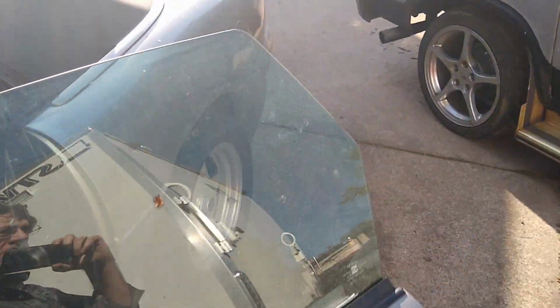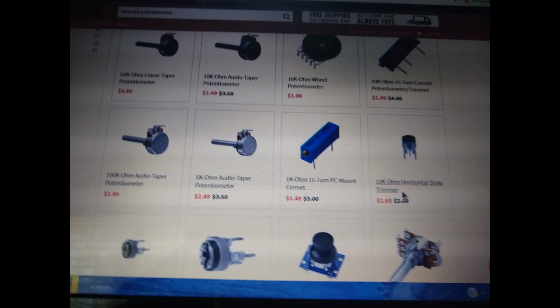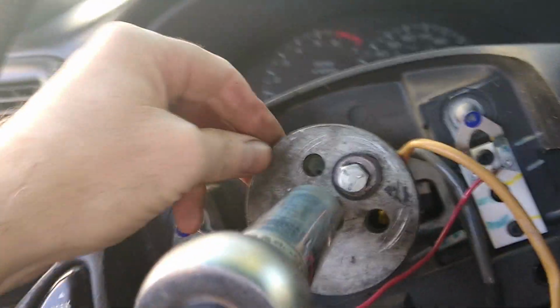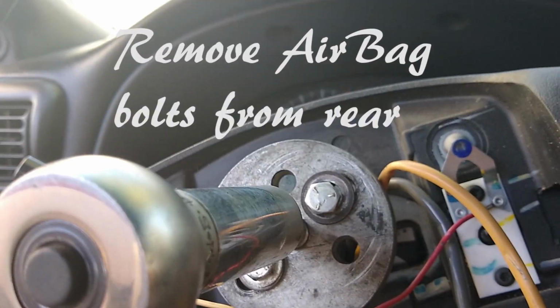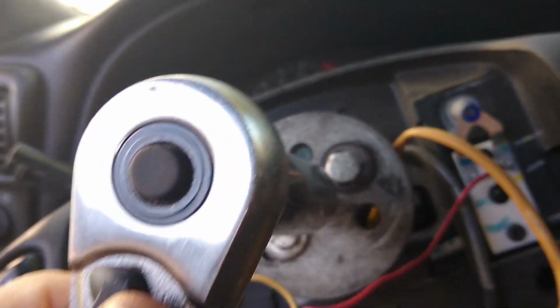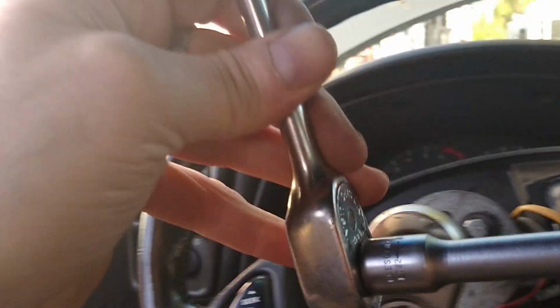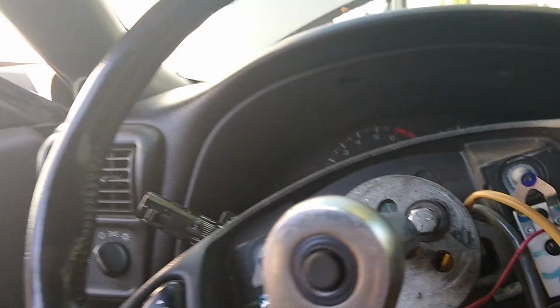So what we're going to do is show you what we got. And here's my trusty old gear puller from 50 years ago. Fortunately, the steering wheel takes a 5/16 coarse thread, so I used my two little bolts here, and I'm taking a 3/4 here to get down on this, take it off. That bolt that was holding on the steering wheel, I ended up using just an old 13/16 setup to get it loose, get it off of there.